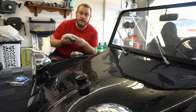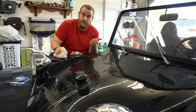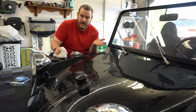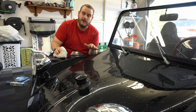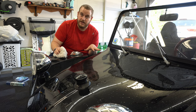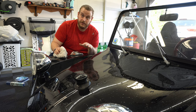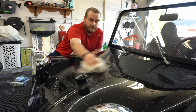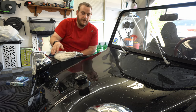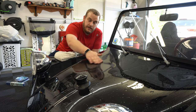You may be wondering: how do you know if you need to clay, and what is clay for? Clay is to remove contamination — like sap, overspray like this car has, or any other industrial fallout you encounter on your vehicle. It does require a physical decontamination to remove those; yes, some chemicals can help, but we want the least aggressive approach first. You can use a clay towel, a scrubber, or a bar in different strengths. To know if you need to clay, rub your hand on the surface — if you hear a little grittiness, you've got contamination.